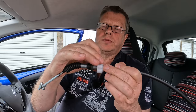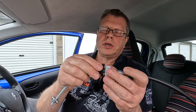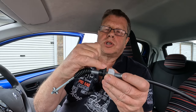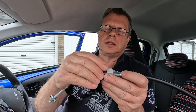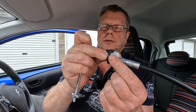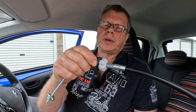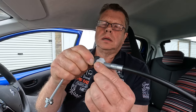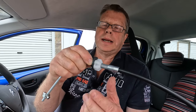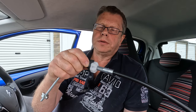One complete rotation of the nut moves the pedal by about a quarter of an inch, about six millimeters, so we can move the pedal up and down by rotating this nut clockwise or anti-clockwise. On this rubber grommet there's what Toyota call a fixation pin - a little piece of rubber that sticks out and engages with one of the flutes on the plastic nut. Normally when the cable is resting against the rubber grommet we can't rotate the plastic adjustment nut, which causes a lot of confusion - people assume it's seized and spray WD-40 on it.